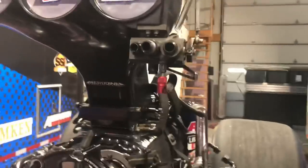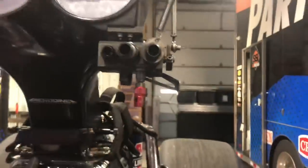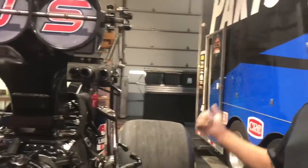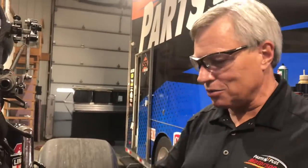One other fitting on here — this is our fuel pressure line, a quick disconnect line. That line can handle the 750 pounds of pressure the fuel pump makes when we go down the racetrack, and it allows us to take it apart quickly. The guys wish they had these on all the lines, but no such fitting exists that can give us the flow we need without being egregiously heavy. So essentially it's a data-gathering port — it also goes to the dash. It goes to a pressure channel transducer displayed on the dash so the driver knows what's happening.